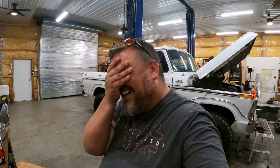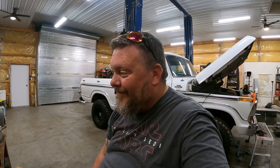All right, so calling around to all the parts warehouses, and Edelbrock is saying end of the year for an intake. The Weiand, the Chinese knockoff, they're saying October for an intake on that. I'm going to have to start doing some deep diving on eBay or something like that and see what we can do, because we can't throw the factory two barrel back on this because this cam's way too big for it. That's just not going to be an option. So we're calling it quits for the day, and I'm going to have to do some research and see where we're at.